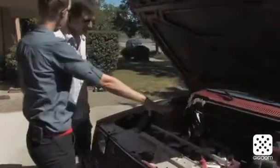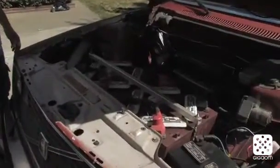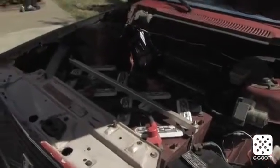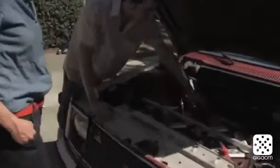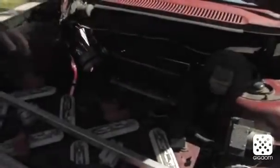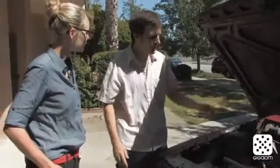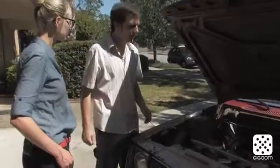So these are half of the batteries right here — four out of twelve, so a third. The other eight are in the trunk. They're deep cycle lead acid batteries, and they power this electric motor that is controlled by the Curtis controller. It has pulse width modulation, where it gives pulses of 144 volts to the motor, and it powers the car through the original standard transmission.